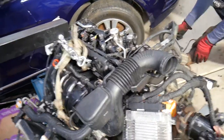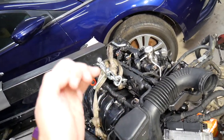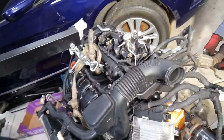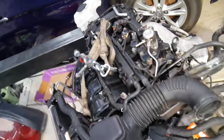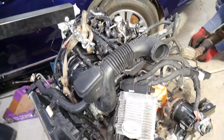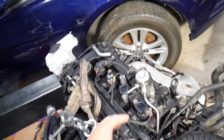In some cases the fuel pump can fail completely. If that happens, you may start the car, it will run for about a second, then die. It will start and die repeatedly until it eventually runs out of fuel and won't start at all. If the high pressure fuel pump goes bad, your car may not start at all, or it may start for a very short amount of time and then shut itself off — it will essentially be running out of fuel.